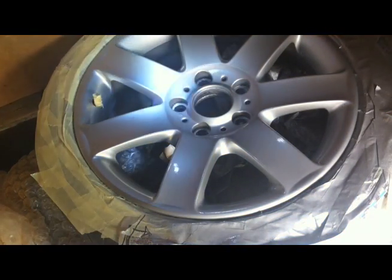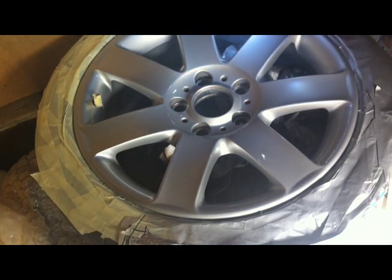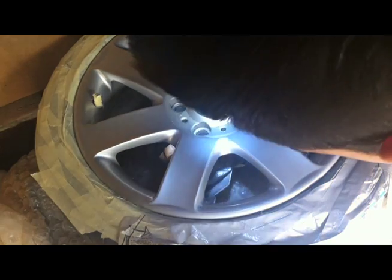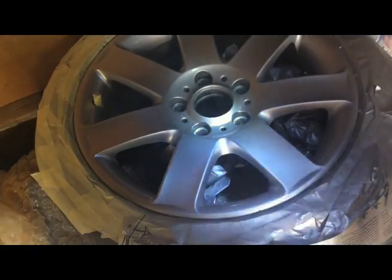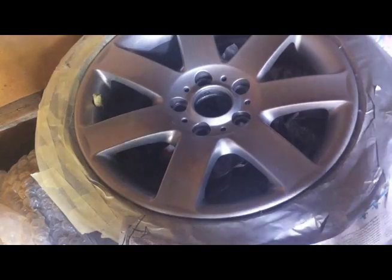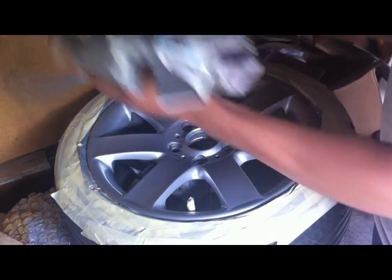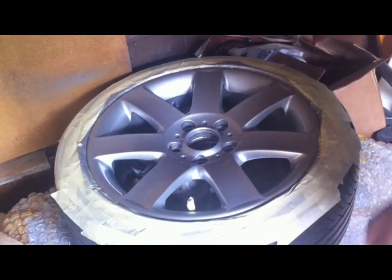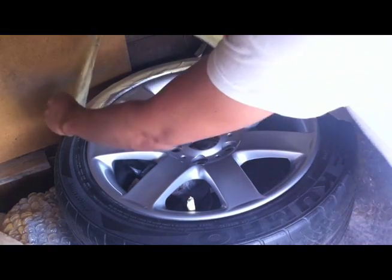Right guys, with a clear coat you have to go on nice and thick, so first of all put the light first coat down, then with the second coat, don't be scared, go on thick, use the light, keep an eye on the paint. As you can see in the video, you can see where the gloss shine comes up. That's what you're looking for, then you know it's on right. If you spray it on lightly like we did with the colour, it won't come out like that factory finish. Alright, so nice and thick with the gloss, don't be scared, it won't drip. Just keep an eye on it, you'll see it kind of do an orange peel effect, and then all of a sudden it'll go nice and thick. That's when you stop and move on to the next bit.